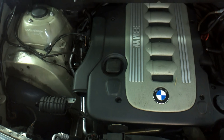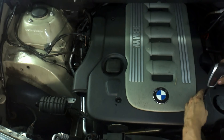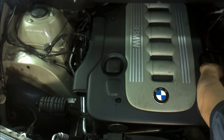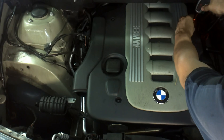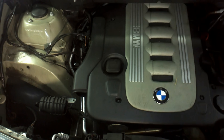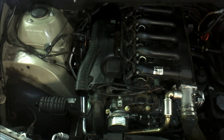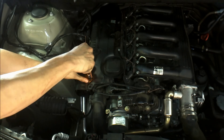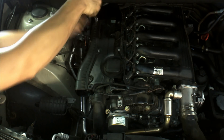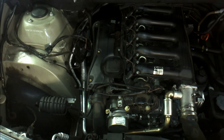Next step we're going to be taking off the engine cover. That's the same Allen key bits as you'll be using to take the air filter out — five Allen keys initially, pretty sure they're 5mm. I'm using my Bosch IXO with a quarter inch adapter to a quarter inch Allen key socket. Take that cover off and now you can see everything — the intake, all the injectors and everything else. On the left hand side here, you've got another three Allen keys. With that initial top cover, I usually keep the screws in there rather than taking them all out. That cover just pulls right off.